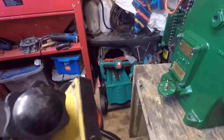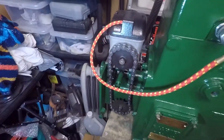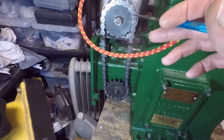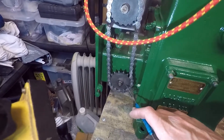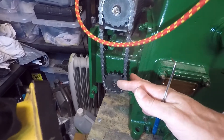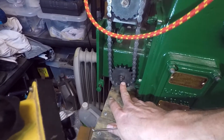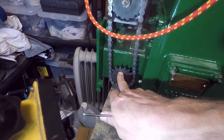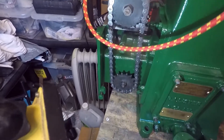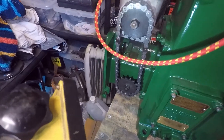Once I had that, I'll show you what it looks like on the other side. This sprocket I had fixed to the magneto, and this one I hadn't. What I did was position the magneto so it was just about opening on the points, then I secured this sprocket so it would move in time with the 20 degrees before top dead center mark.